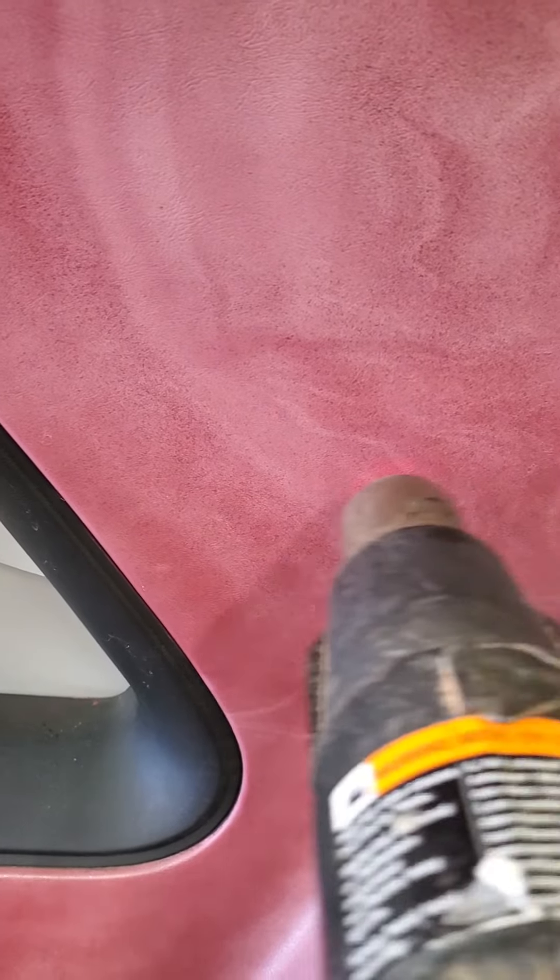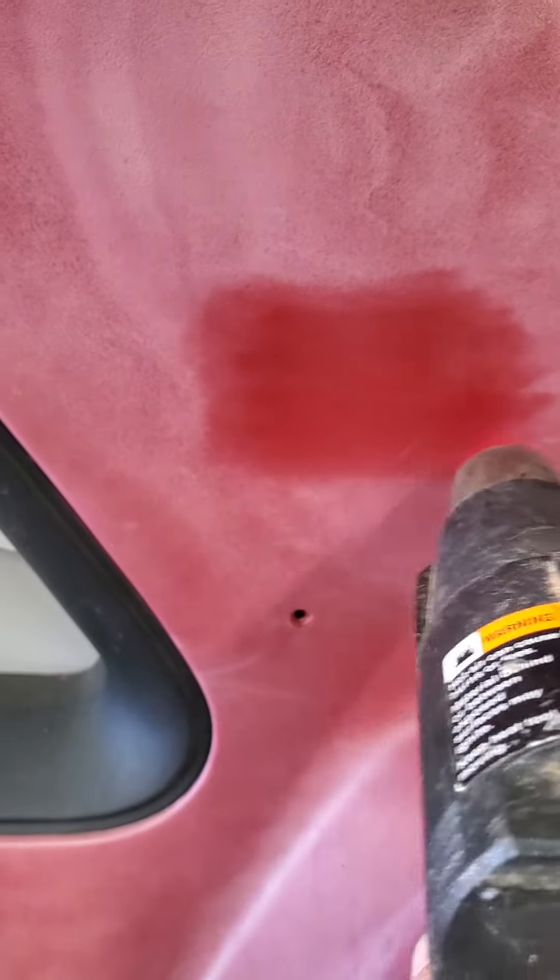So you see how it's pretty dull. You got to be careful — get your heat gun nice and hot, start in a safe spot, keep it moving. You don't want to completely melt it. You're basically putting that nice shine back on. This is pretty bad, so it might take a couple of rounds, but this will work on any color.